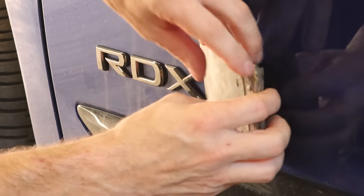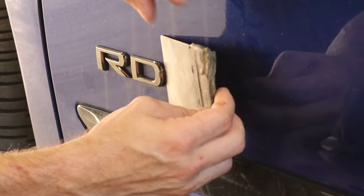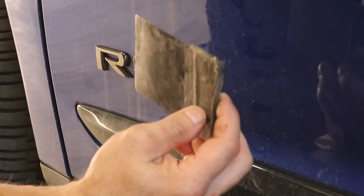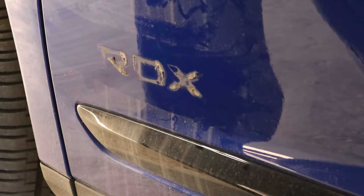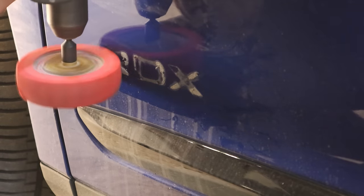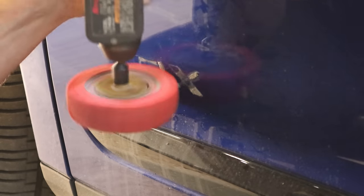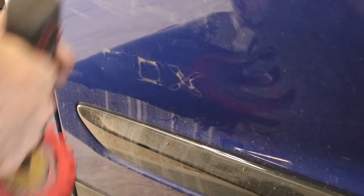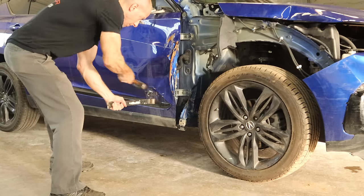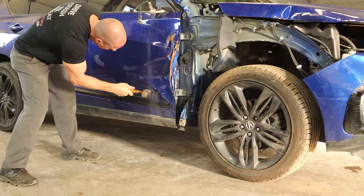The scanner says it failed, but apparently the task was failed successfully because it relearned our TPMS sensor. I can't bear looking at this nameplate any longer, so we're going to pull it off our driver's door. I'm sure the dealer stuck these on there and called it some enhanced branding package and charged the first owner $5,000 for it when it was new. Just slide the spatula back there and it falls right off. Clean it up a little bit and use our magic eraser to get rid of the rest of this glue. This is not the OEM two-sided tape so it's a little gooey and takes a little longer. A little warmer up in this corner and the rest of that residue will come off with some wax and grease remover. I also have the new nameplate remover 5000 — much quicker, but be careful, it will scuff the paint if you don't use it correctly.